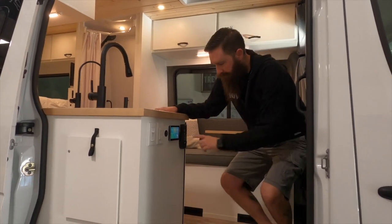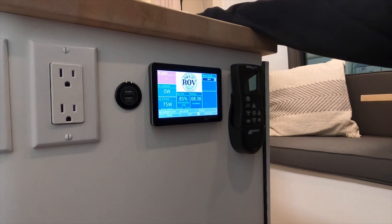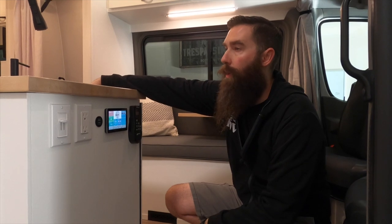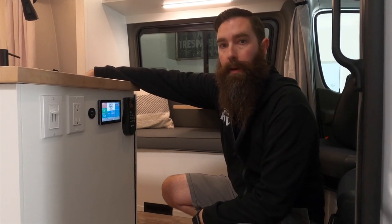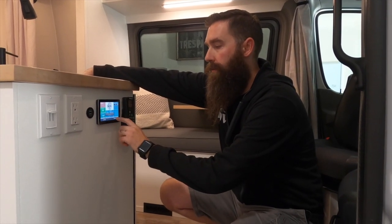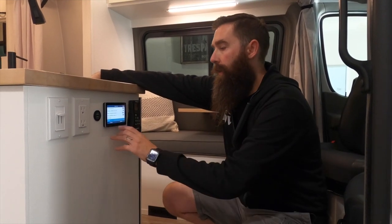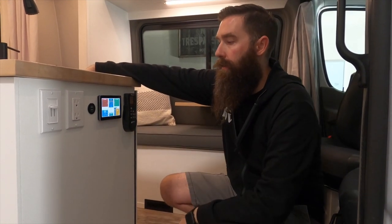Something we did this time was the Cerbo GX and the Cerbo touchscreen. This lets me tie into the electrical system and monitor the tank. The KUS brand water level sensor is compatible with the Cerbo, so you can tie it right in. You can see it says fresh water 87%. I'm also having it monitor temperatures in the refrigerator and by the water tank, so I can keep an eye on those temperatures really easily. There's all sorts of other things you can do with this — I've really been having fun figuring it all out.